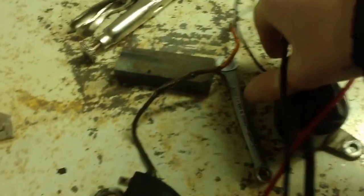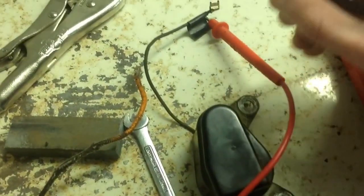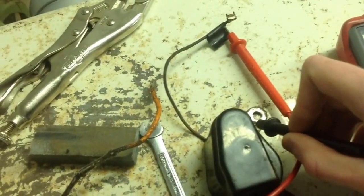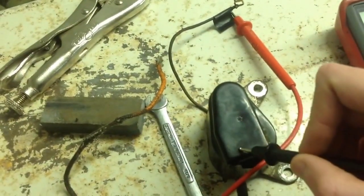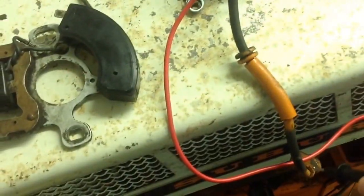The reason why it's shaped this way is because right here, there's one smaller coil that goes from this wire. One end is in the wire and the other end is this plate. Then there's a step-up transformer — pretty much a step-up coil — because there's a bigger winding up here. And that goes from the plate to your spark plug wire.